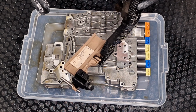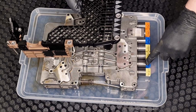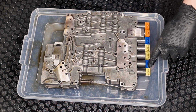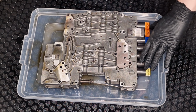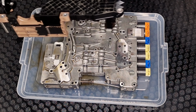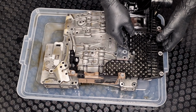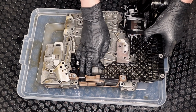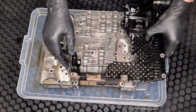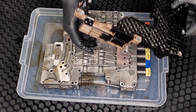And basically that's it. So I'm ready for installation, and I haven't torqued the plate which keeps the solenoids, just because they are going to move a bit and I don't want to limit their movement. I saw that some people torque them later, so it's okay. Make sure that it's not visible, but it should fit properly. And by the way, also those pins here and here, they should go in the special places.